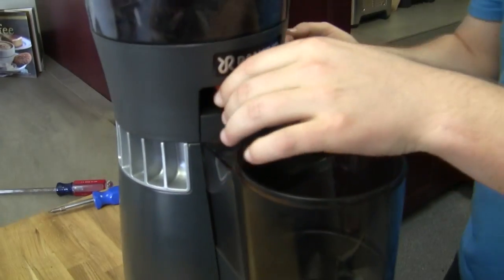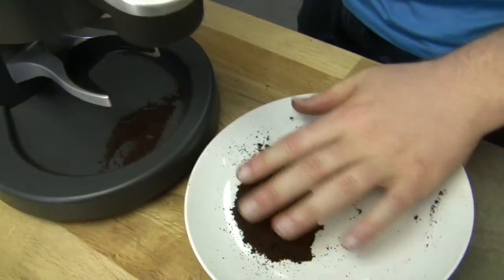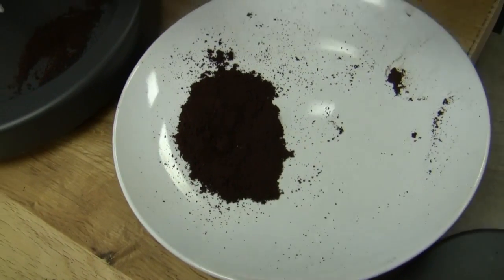You can see — we were pretty close — and that's the whole point of really getting those burrs to touch: it gets you so much closer and you don't waste much coffee. Now let's open it up as coarse as it'll let me until I hit that ring — about a good 15 seconds or so. Let's check consistency — it looks great. It's grinding out really fast as far as dosing time goes. Dosage wise we should be between four to five seconds for roughly a 14 gram draw and it should hold up to that. Obviously it's an espresso grinder so we are going to go coarse just to see where it goes and how consistent it remains. It's completely stepless, you can really go to chunks if you will, though that's not its purpose.